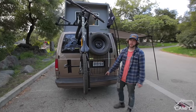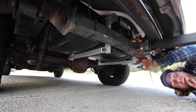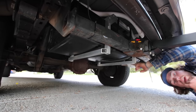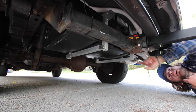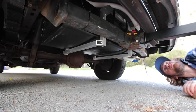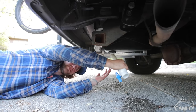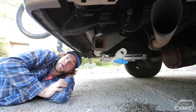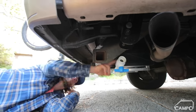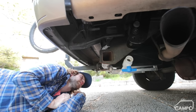Under the van I have a 15-gallon gray water tank from Amazon. I had to drill my own fill and drain ports, then I built an aluminum bracket from leftover tube aluminum and added straps to keep it from rattling. I just turn the ball valve to drain it — if I'm in a safe place I can dump it into a garden. It uses a flexible hose that tucks right up under there, pretty low profile and out of the way.